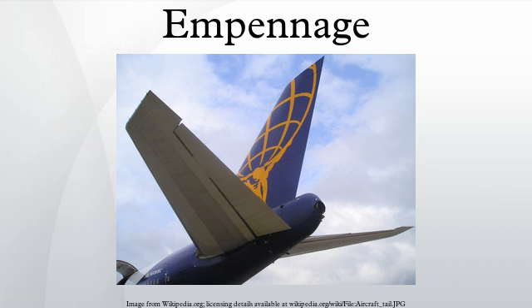In some aircraft, trim devices are provided to eliminate the need for the pilot to maintain constant pressure on the elevator or rudder controls. The trim device may be a trim tab on the rear of the elevators or rudder, which acts to change the aerodynamic load on the surface — usually controlled by a cockpit wheel or crank. An adjustable stabilizer may be hinged at its rear and adjusted a few degrees either up or down, usually controlled by a cockpit crank. A bungee trim system uses a spring to provide an adjustable pre-load in the controls, usually controlled by a cockpit lever.